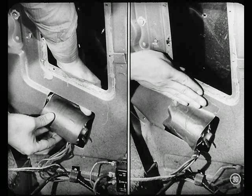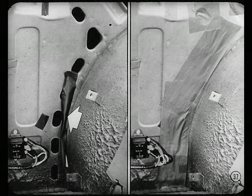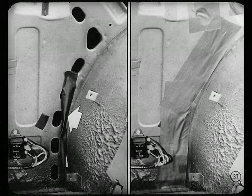Almost the same, Jim. Only you apply strips of tape around the motor so the wires will come out from the top. Right. Then apply tape to the panel above the hole and tuck it under the motor inside the door panel. Finally, cover the entire opening with tape. If you see any wrinkled sections of tape, replace them with new tape. In fact, play it safe and seal all access holes, screw holes, and unused openings. Okay. I'll tape every opening I can.